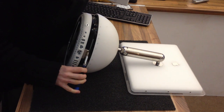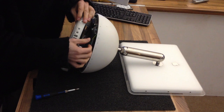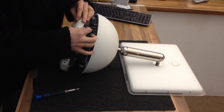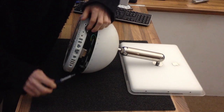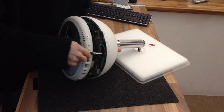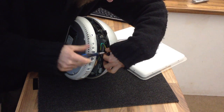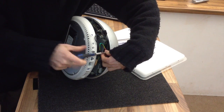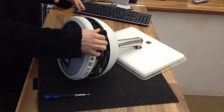We've got the power cable here. This actually has a removable point. If I pull this out slightly and pull this out, we should find, there it is, a disconnection point there. And if I get onto that earthing point, just turn this around so you can see it again. I just undo this earth screw as well. There we go, that's that.